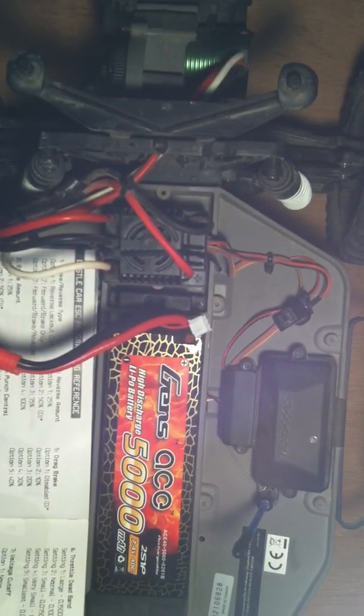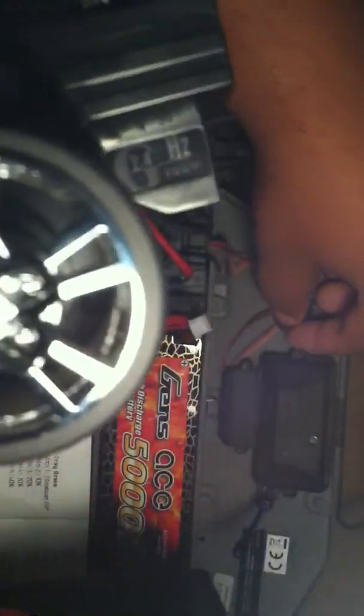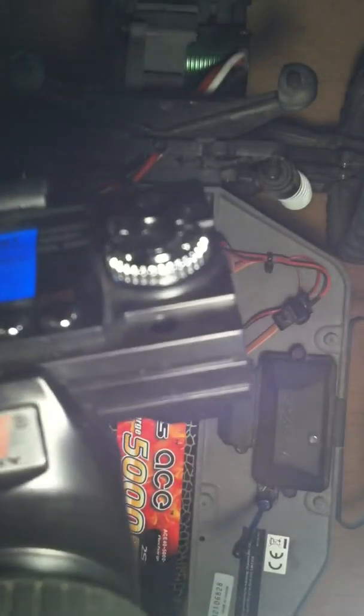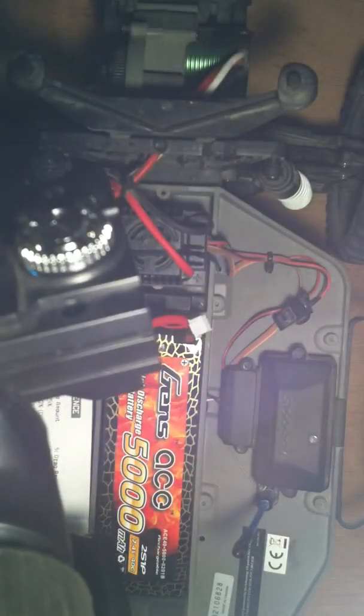My pinion is off. So how are we going to start? I'm going to take my 2.4 transmitter and turn it on. When you do it with any of your remotes, you hold your throttle down — hold it down — and then you turn your ESC on. When you turn your ESC on, it's going to make a series of beeps. And then once the beeps stop, you let off.